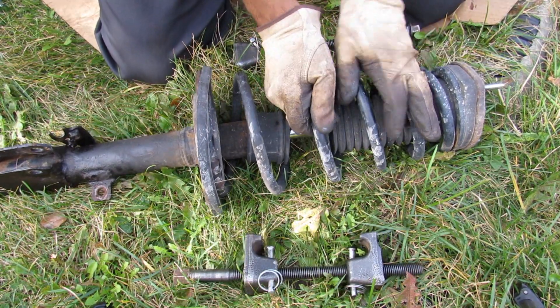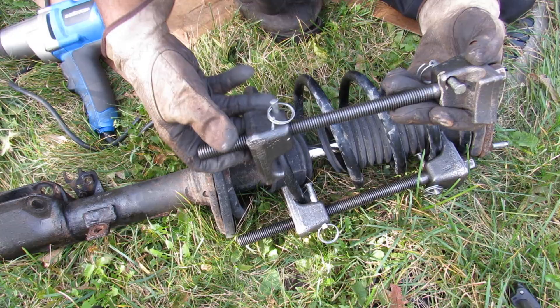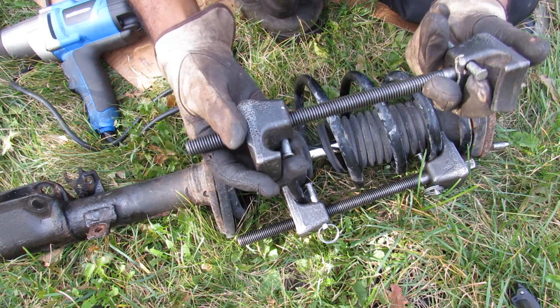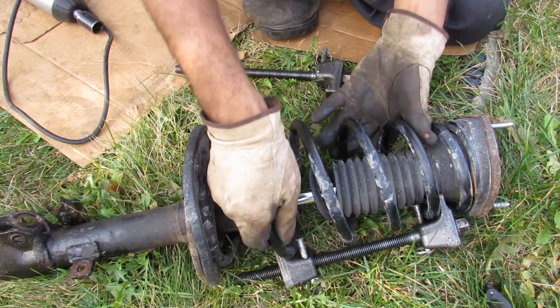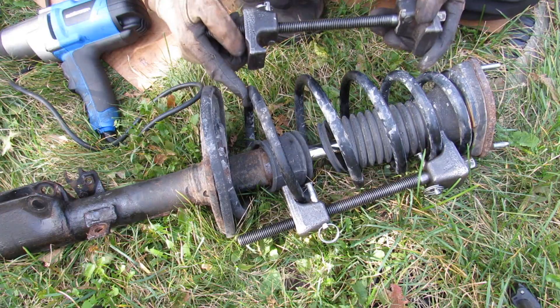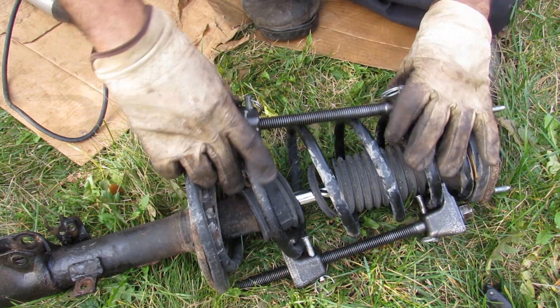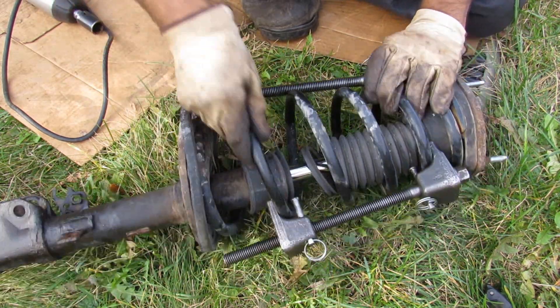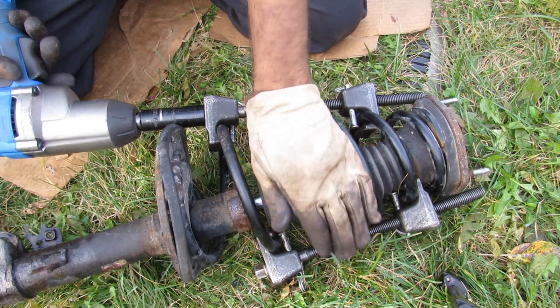This is the old strut removed from the vehicle. We've got the spring here with a preload on it between the strut and the strut mount at the top. I'm going to be using these manual spring compressors — you really have to be careful with them because there's a lot of tension in these springs. Position the strut so it's not facing your jewelry, and if you are a man, make sure you wear a cup. Install the compressors roughly 180 degrees apart and slowly drive up each side to compress the spring.